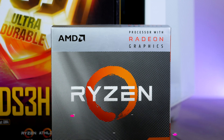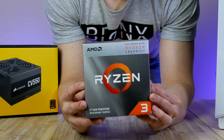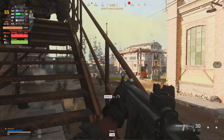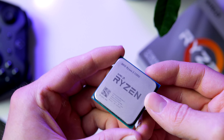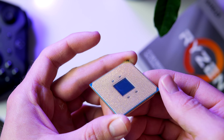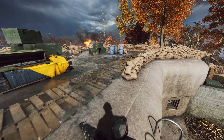We're going to pair the B450 with the Ryzen 3 3200G, coming in at around $175. This is a four-core APU with onboard Vega graphics, and the onboard Radeon graphics will act as the graphics chip for this gaming PC. The APU is overclockable, which means you can overclock the GPU and expect even more FPS. It has a 3.6 GHz base clock and a boost clock of 4 GHz. Let's take a quick look at the gaming performance with the 3200G — the $175 processor doesn't disappoint.